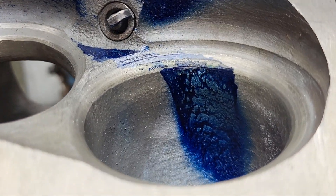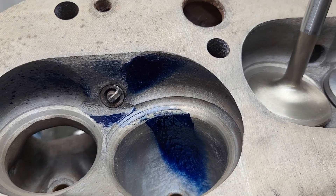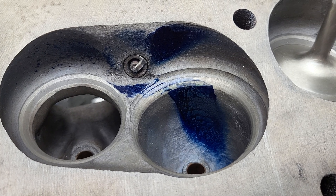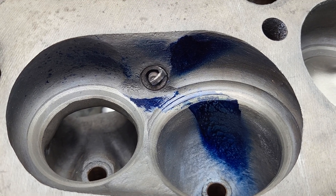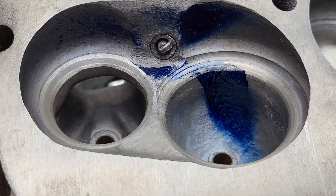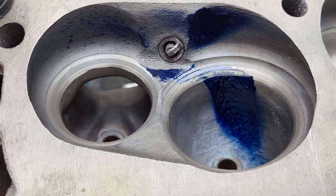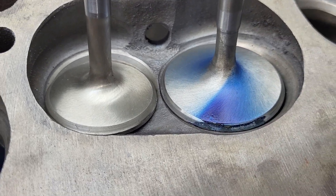I am going to do some work to these. The reason I even have them out is I've got a customer with a 38-foot boat with twin 565 big blocks. He's got a set of AFR heads that Eric Weingartner fixed up for him. He's sending me the flow numbers that Eric got, so basically I'm putting this together to get a comparison — that way I have something I can bolt that intake to. And because it's 90s porting, I'm pretty sure I can get a few more CFM out of them with what I know today.